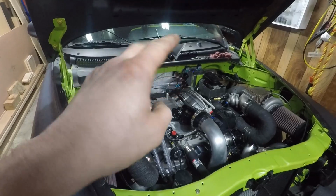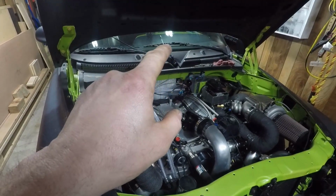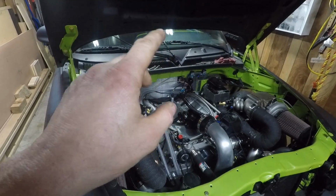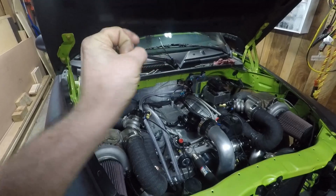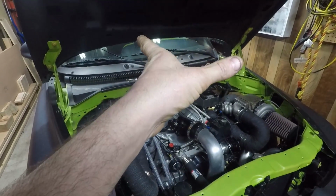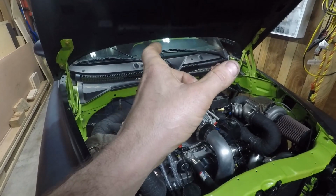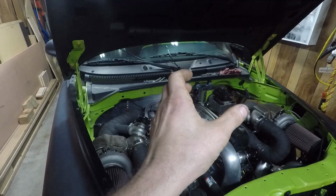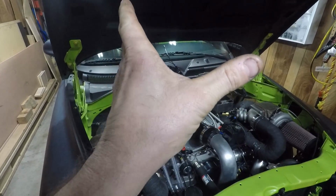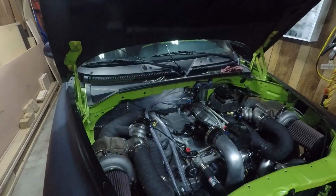It's going to have your left and right turn signals, a blue indicator for the high beams, and then what I'm doing is putting two super bright half-inch LEDs, one in each corner of the display, and they're going to be tied into the shift light. So when the shift light on the tach goes off and it goes off on the digital display, it'll still flash. It'll also flash the red LEDs in your face, so you can't miss it.